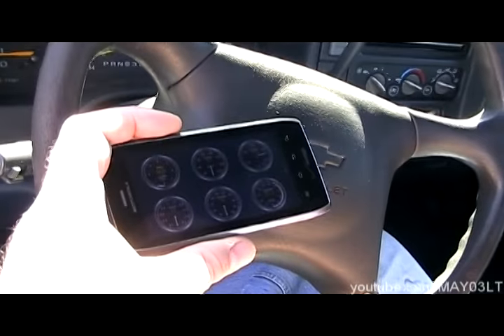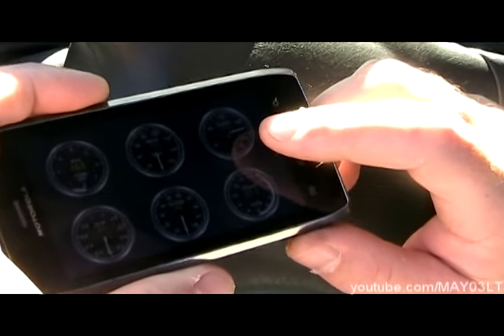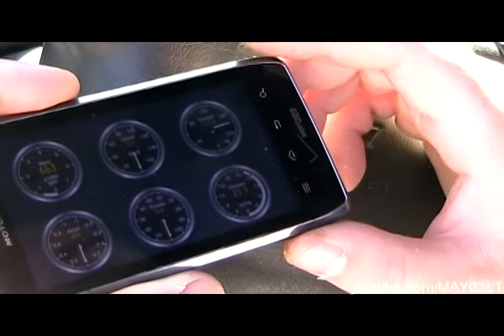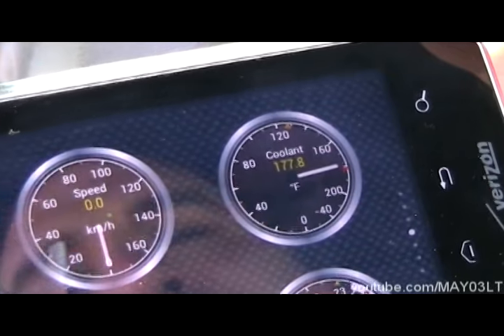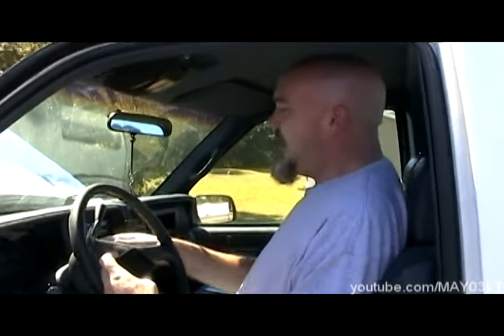So what I've done, I hooked up my cheapy little OBD2 plug-in, Torque app, and I am actually reading that the coolant temperature is 177.8 degrees. It gets up to around 181 and then the thermostat opens and she drops back down. So I'm at like 177 here at the PCM, but my gauge is always reading low, which is kind of weird.